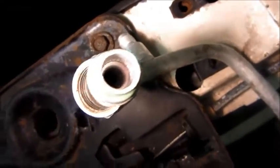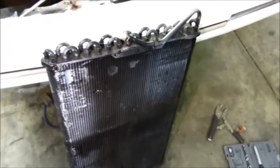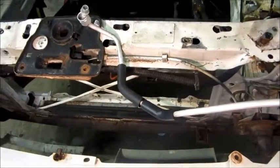I've got the condenser coil all cleaned out inside and out, and the same goes for the newly modified liquid line — no leaks there. The end of the condenser had a lot of sludge in it, but nothing like the original system on the car. What I'm thinking happened: there was so much piston seal material in that system. I think they just kept putting compressors on one after another — put one on, it would fail, put another on, it would fail — and never flushed the system. When I first tried to flush this liquid line with the caustic cleaner, it was blocked 100% and I had to use the pressure washer to blow through it. But it's clear now.